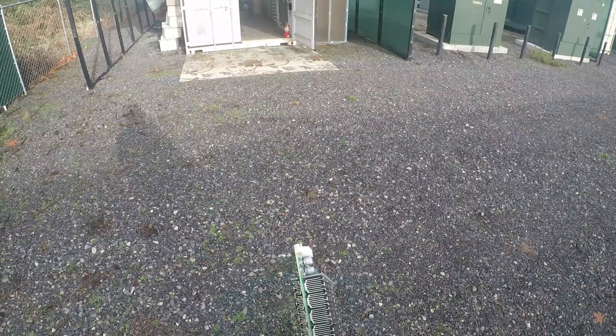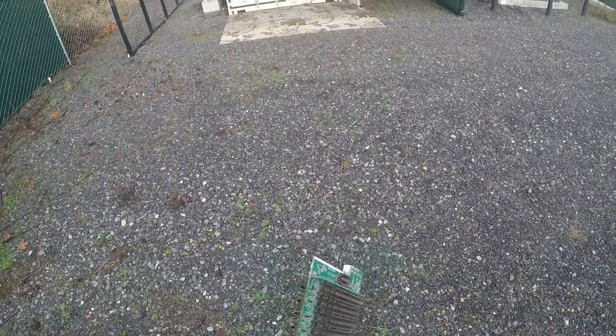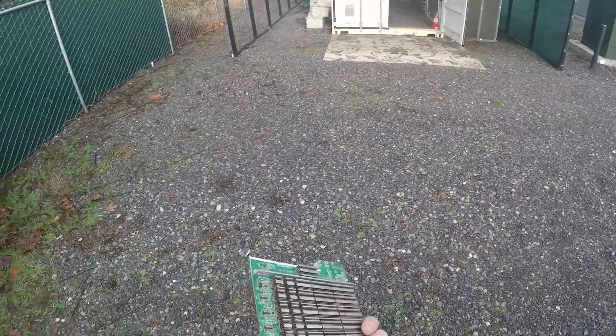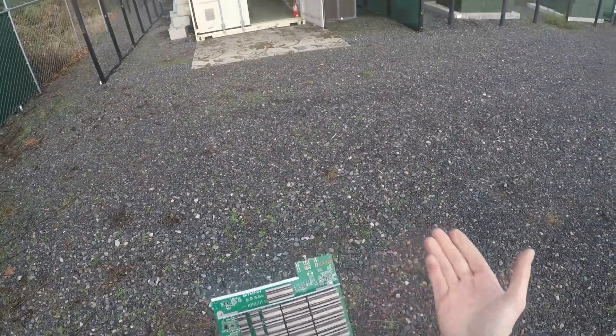That's how clean we hold all of our electronics, hashboards, and GPUs. We have a polyester blue half-inch filter installed that blocks out dust and garbage — it's not just a bug filter, it's actually a dust filter. So after running for months and months, things still get through, but very, very little. You can see the back as well — there is no humidity damage, no corrosion or rust. We hold all our hashboards and miners in perfect condition so they don't overheat and there's no humidity damage. If I just take an air blower and blow it off, it'll look brand new.